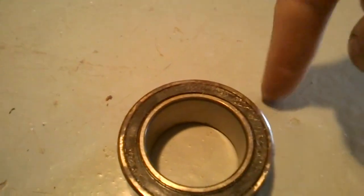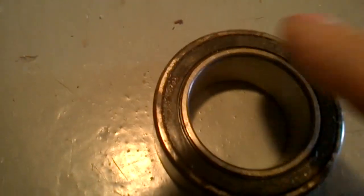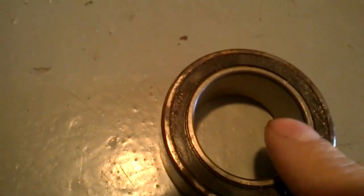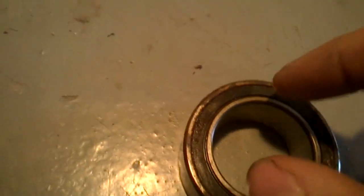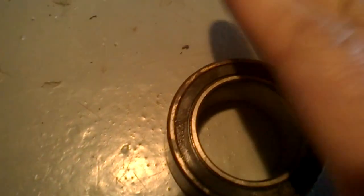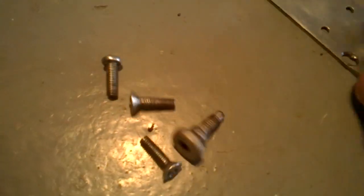So no side forces. When pressing the pulley with the bearing back onto the compressor shaft, try to tap only on the inner race area. It's not easy — you may need to find an adapter. At any point don't crush the seal. Strongly suggest not tapping on the pulley surface.